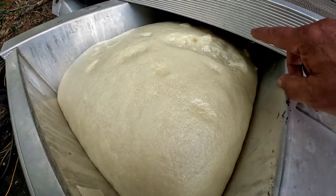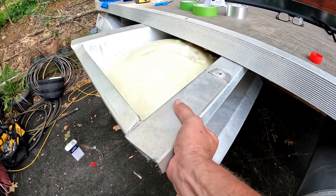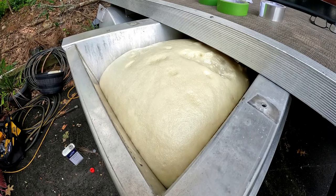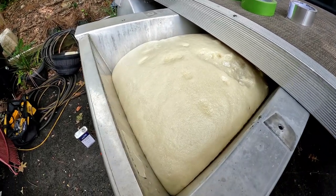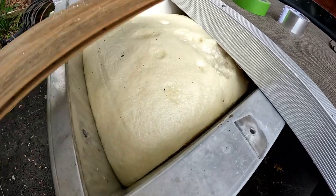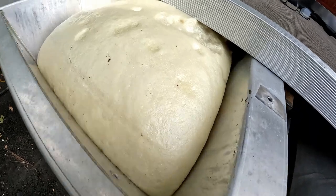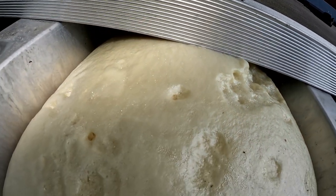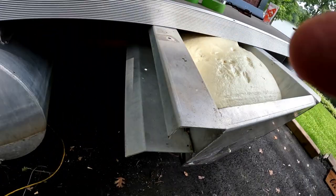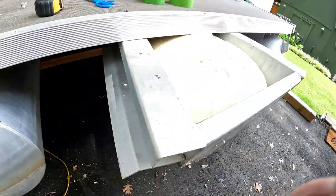She's still continuing to rise, almost at the top. I put the front of the boat down to try to move some of it towards the front and gave it a little jiggle. It looks like it's going to do it — just like baking bread. I measured two cubic feet and in just a matter of minutes the foam is as hard as a rock. It came up just to the top of the deck band, which is going to provide nice flotation all the way up on this big unit.